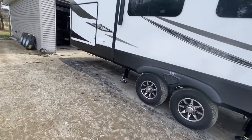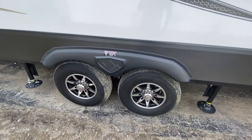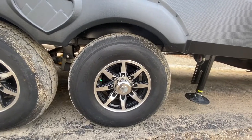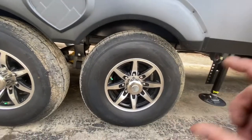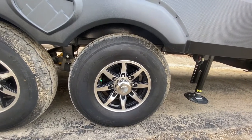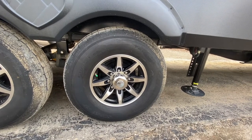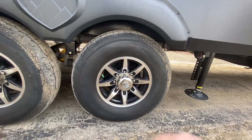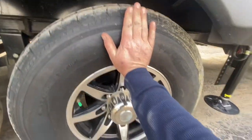So what I'm working on today is running gear. These are the factory wheels and tires — they're 16s, eight-lug obviously. This thing runs 7,000-pound axles because it's a GVW of 15,500. The tire size is ST 235/85R16, the taller of the 16-inch, which actually in my mind makes things worse. These tires are marginal at best. I don't know if Westlakes are made in the USA or if they're China bombs, but regardless they're not a high-end tire. Look at that sidewall — I have big hands and that's like a seven-inch sidewall.